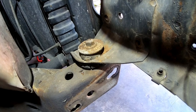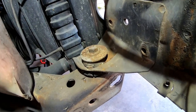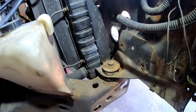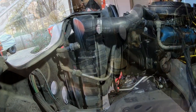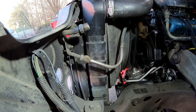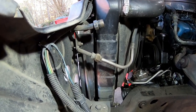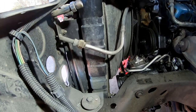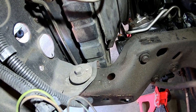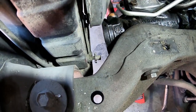I'm not going to take that bolt off until the very end, because once I disconnect all the lines on both sides, I believe just two bolts are holding it — this one and the one on the other side. On the driver's side you've got the upper radiator hose, two AC lines that connect to the AC condenser right in front of the radiator, and that body mount-looking bolt. Again, saving that for last.